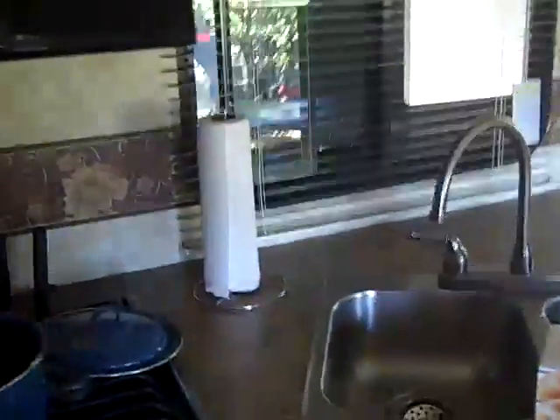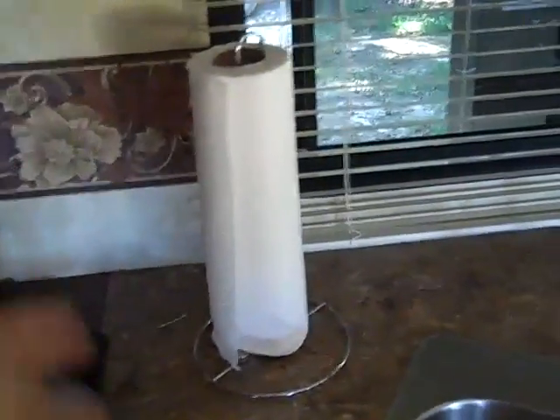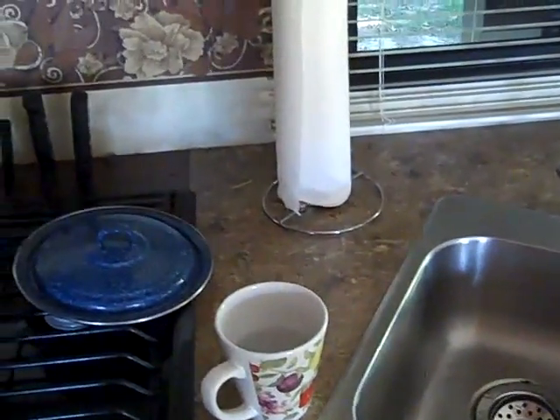We can use just about everything in this RV except the air conditioning unit. You can live without that. Everything else — every other convenience, including the ability to keep your food cold — is available. Let me check if we warmed up the water. Oh yeah, that is hot — hot, hot, hot. So the microwave is running off the Sunrunner. The microwave is probably the biggest hit to the system at 1,500 watts, but it's a 5,000-watt inverter with a 10,000-watt surge. I just can't start the AC unit.